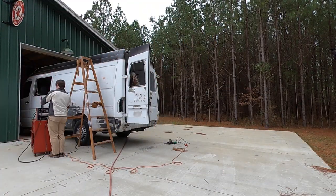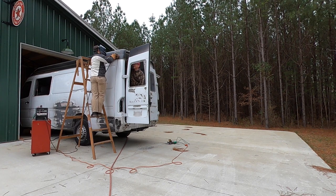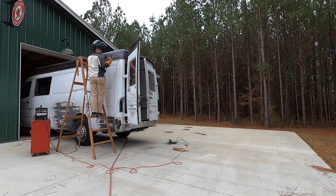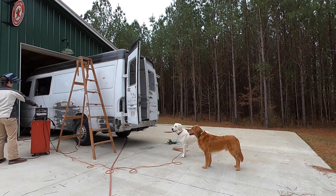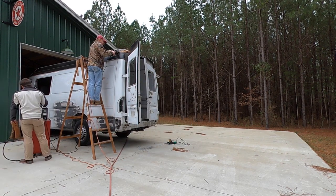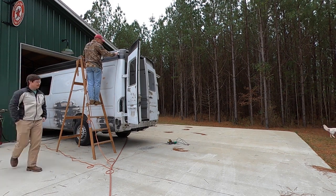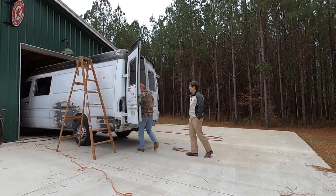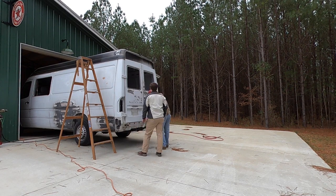We got the welder set up, welded the holes solid, then came back with the grinder with a flapper disc and smoothed out all the metal. We knew we'd need to put some bondo over it to fill the low and high spots created from welding — there's no way to get it perfectly smooth when adding that much material, even after grinding. We had to clean up that area and get it ready for bondo. The paint was pretty thick in this area so we took off a good amount to feather the bondo in better and reduce any visible seam over the welds.